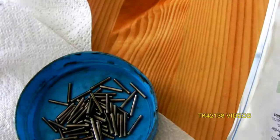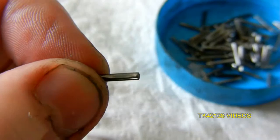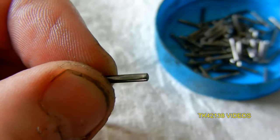I don't know if you can see this — I'm going to try and get this on film. I'm using a magnifying glass as you can see. Can you see that little flat there? That's not supposed to be there, it's also slightly distorted, it's not parallel. I can't get any closer than that I'm afraid.